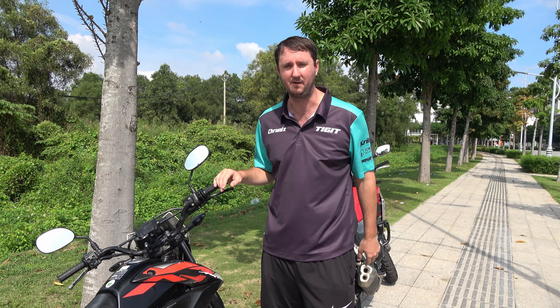Now we're going to unscrew it and we'll see where we're at. Every dipstick is different on different bikes, but basically you're looking to have the oil on the bumpy bit. So this area would be full and down here would be empty. You could argue this bike has too much oil, but basically it's fine — it's good. Now that's done and we can screw it back up again.